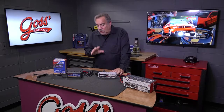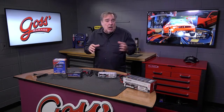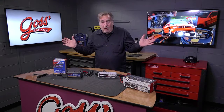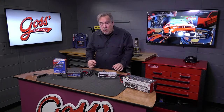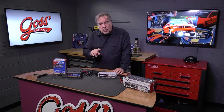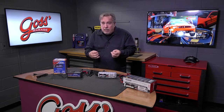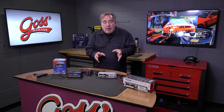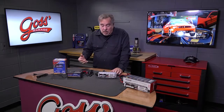So what do you do? Well one of the things that you don't do is go out and buy a trickle charger. A trickle charger is a small battery charger that produces just a small amount of electrical energy that a lot of people like to hook up to the battery, thinking they're going to be great come spring. In reality, what they typically do with that trickle charger is cook their battery. A trickle charger continues to charge all the time — it may cut back a little bit, but there's always a charge going into the battery, and that continuous charging after the battery is completely charged actually damages or destroys the battery over a long period of time.